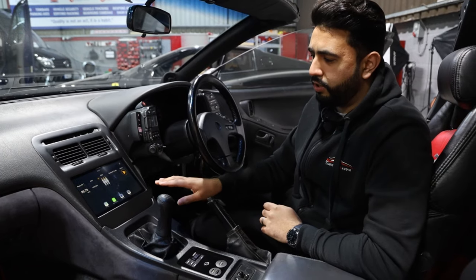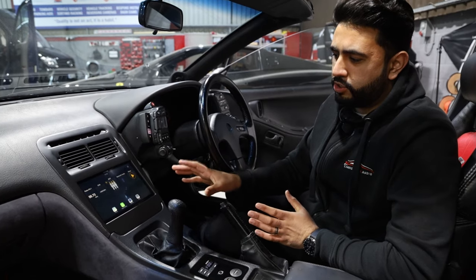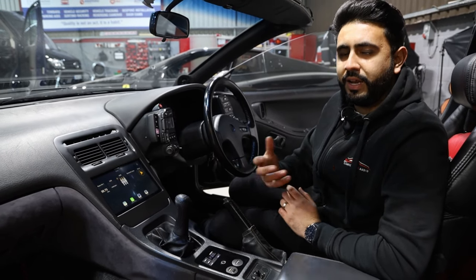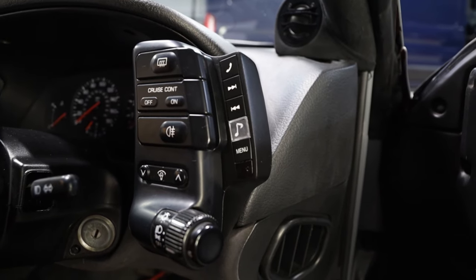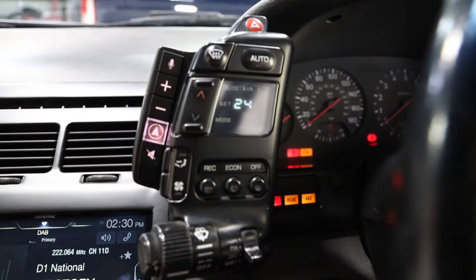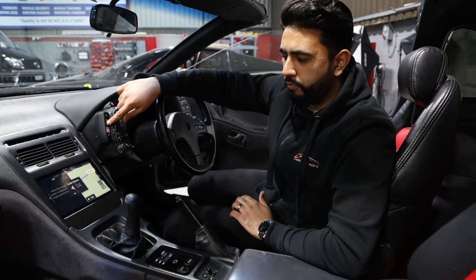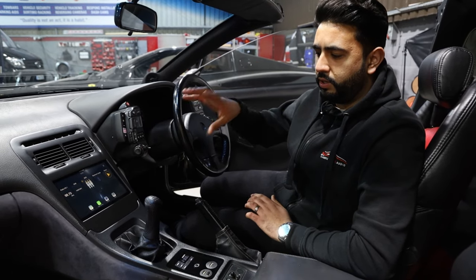What was said to never have been done before, we've done it here at Cambridge Car Audio. We've added in the Alpine 9-inch freestyle unit, giving a really nice clear picture on a 9-inch screen, plus the radio units behind that. This freestyle unit also allows us the ability to relocate and add steering wheel control. On the back and sides of the housings, we've added in custom-built fiberglass pieces — a lot of time has been spent getting these right. They form in really nicely, give a really nice curve, and we've painted them black to blend in, giving full steering wheel control retention for the 9-inch screen on both sides.